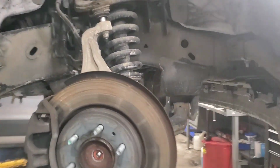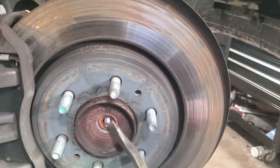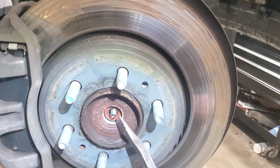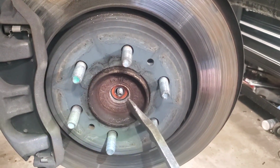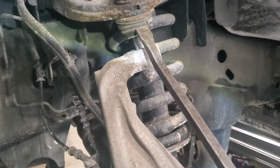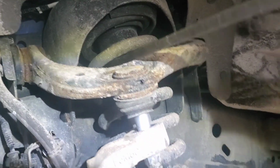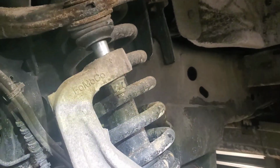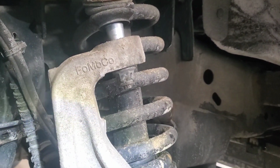Okay, some models are 13. I did put the nut back on there, just slightly tap it, it started moving immediately. Some models are 13, some are a 15. Maybe they're all 15 and I'm just tripping right now, but I remember pulling a 13 off some of these models. But anyhow, to get this up here after you got it loaded back up safely, I would take my pry bar, kind of put it back here behind the spring on an angle, and you'll see it'll start to loosen. It'll start to put tension on that, and then you could actually pull it down far enough to squeeze that nut off of there, and then easily let the bar back up, and it'll be right out of it.